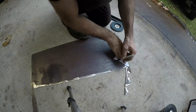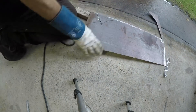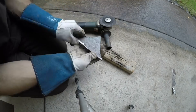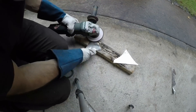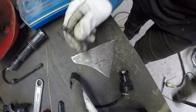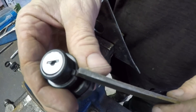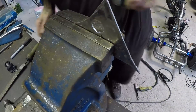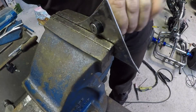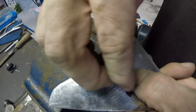There's a little plate I'm going to make to cover the ignition switch. The ignition switch will go on one side, and the other side will just have a plate — I'm just cutting out the profile I marked off. One side will have a hole for the ignition switch, the other side will be a solid plate. I center-pop a hole, use a hole saw, and then there's a little notch on all keys — I pick a file of the right width and just file a little keyway in. File it to the right depth so it fits in there, the nut goes on, and that's pretty much what holds the ignition. I weld this onto the frame.